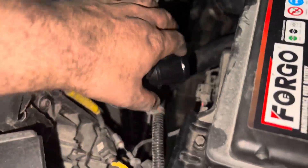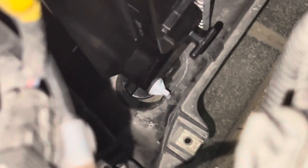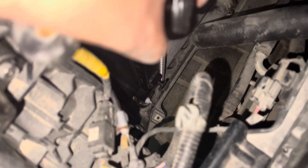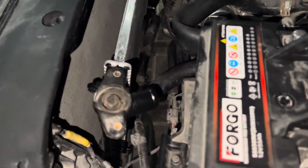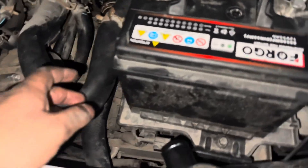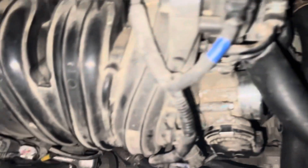What you or anybody should be doing first is: just down there you've got that little valve on these, which is quite helpful. Unscrew that, let all the coolant out — well, as much as you can. There was still coolant in mine once I took it out. Then you remove the radiator hose from here, the one down there, and then that gets all your coolant out.